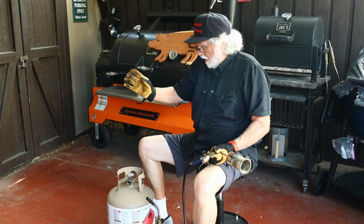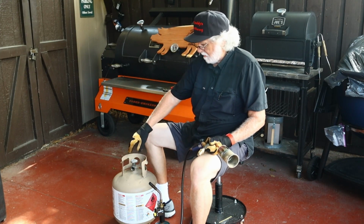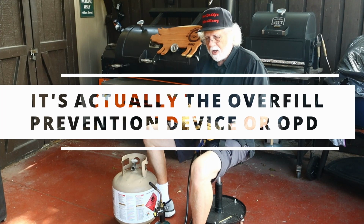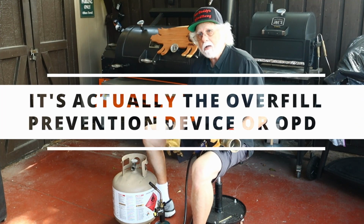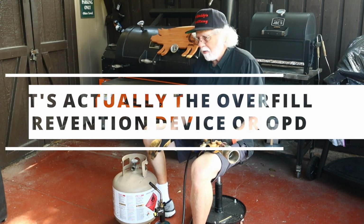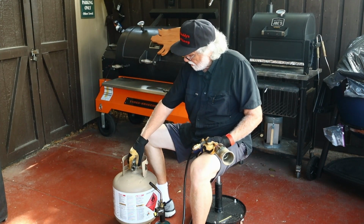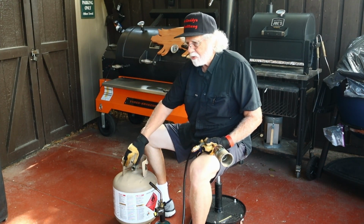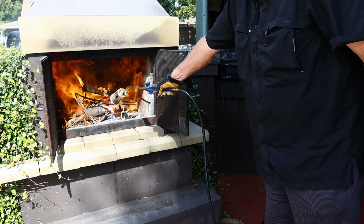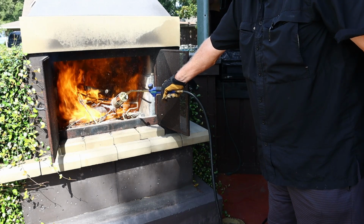On your overfill protection device, that's what they call this valve, you've got threads on the outside, which is what you'd use if you had the big old plastic Acme nut. A whole lot of the appliances in the USA come with that if they're made for the 5-gallon bottle. But these valves all have inside threads also. The thing about the inside threads is they're left hand, not right hand. So it's not righty-tighty and lefty-loosey, it's just the opposite.